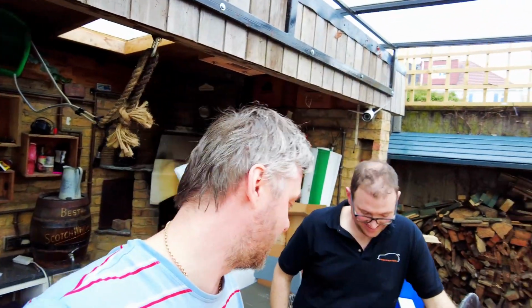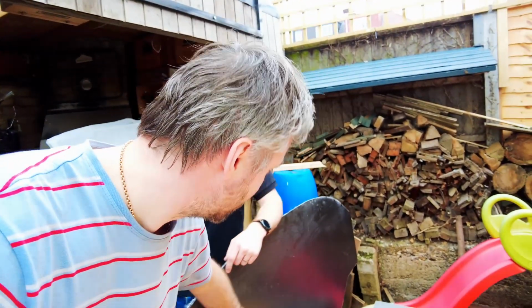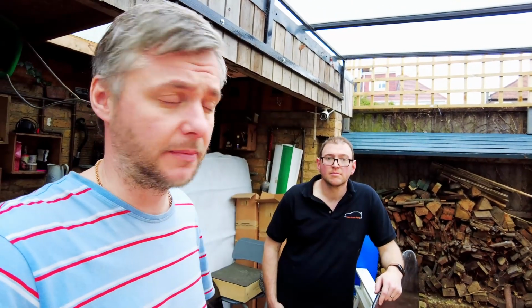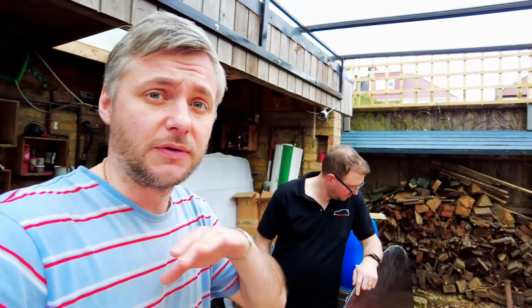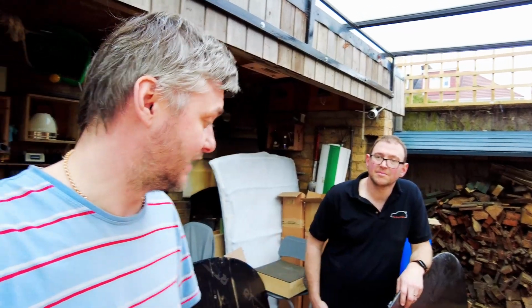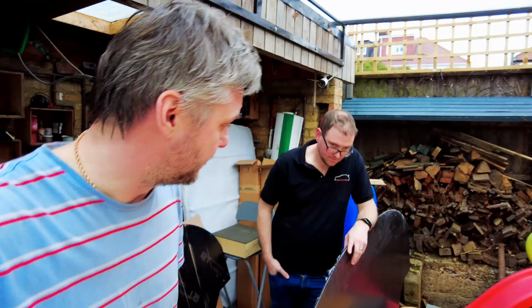There's a few faults, I'm not going to lie. There's a few dry spots that need to be fixed, but it's all easily fixable with just applying another thin layer of resin. And then you can sand it. You can put coating resin on top, or UV lacquer, or anything you want basically to flatten it, to polish it, to make it shinier, to make it UV protected and stuff like that. So it's entirely up to you how you treat those parts.